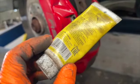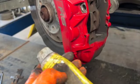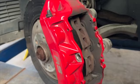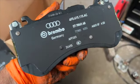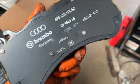We are using Textar brake pad grease — I can't just remember the name of it, plus there's a sticker right over the top of it. I think I've got another tube — I'll find out exactly what that is — but that's the best stuff to use on these. One thing I didn't realise: these are actual Brembo brake pads, so money saving tip — if you want like-for-like, just order Brembo.